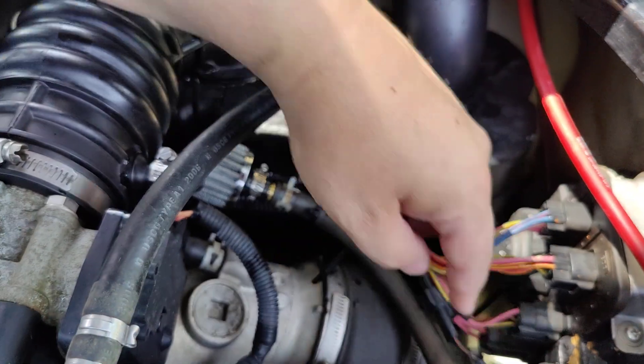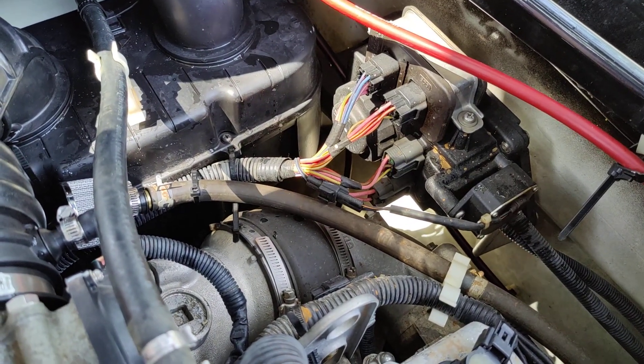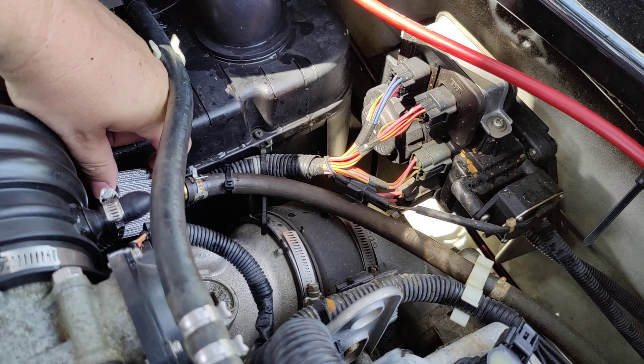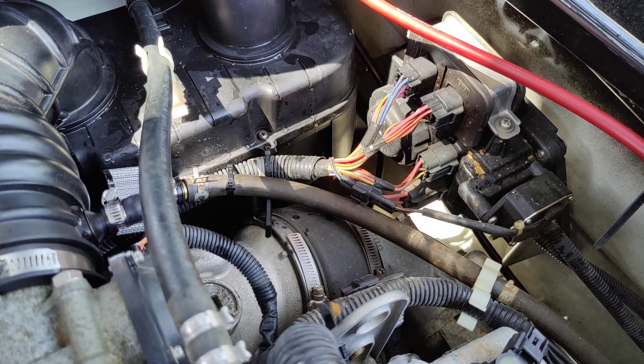So here's that line. This is basically to prevent oil in the air box, even if you overfill it — that's the goal. I mean, obviously this would be a giant mess, but way easier to clean than buying a new air filter.